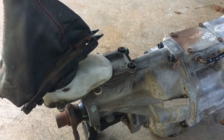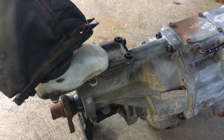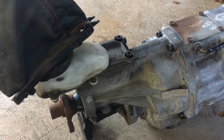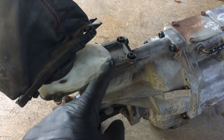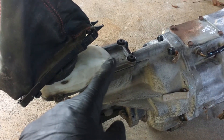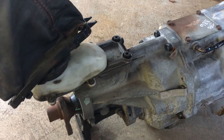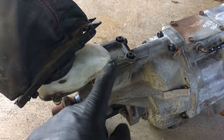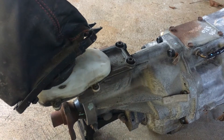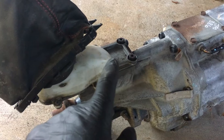You can try to do your own custom one, but the MGW one was 200 bucks — not so expensive. The little cap insert inside the transmission was about 50 bucks from gearbox.com. It has a roll pin, so we'll use the roll pin punch like we did prepping the slave cylinder, and then we'll put the new one in there.